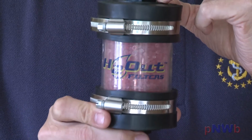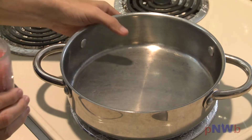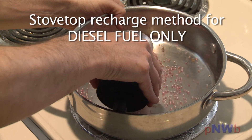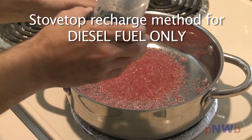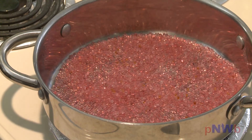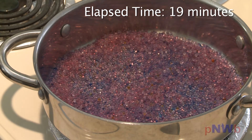When the desiccant has absorbed all the moisture it can — essentially it's full and can't absorb anymore — it turns pink. Here's the best part: it's infinitely reusable. When the beads become pink you can renew or recharge them. Simply remove the desiccant and place it in a pan on the stovetop. Turn the element to medium-low, or low if you're using a gas range. It takes about 20 to 30 minutes, stirring occasionally, to turn the desiccant beads back to blue and ready to absorb water vapor again. Put them back in the unit and reinstall the air vent dryer.